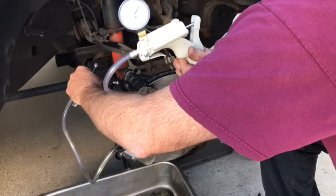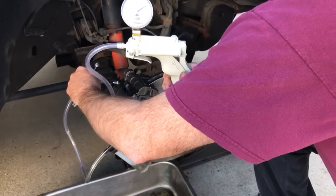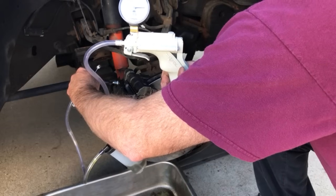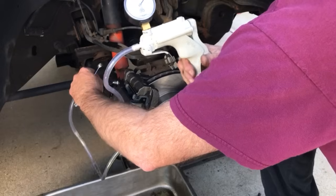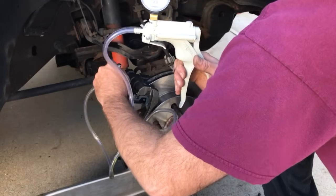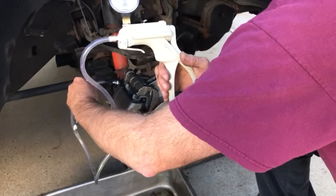What you would do is top off the fluid, then it's probably a good idea to crank it and just pump the brakes a couple of times, and then bleed them once more into the cup just to make sure you get all the air out of the line.